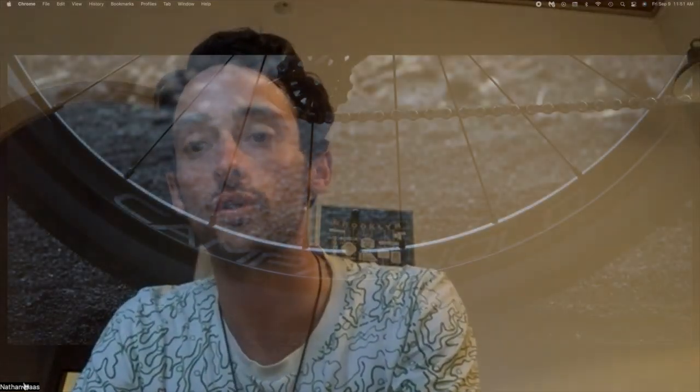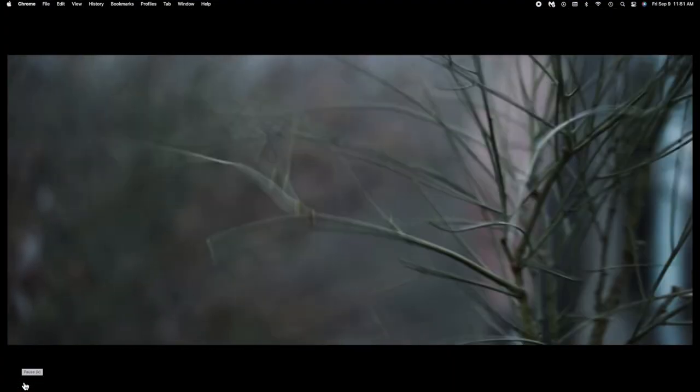One of the cool things about the Levante is it's been engineered so the wheel is almost vertically compliant, but only at the contact point. If you hit a rock or a sharp bump, there's almost suspension in the wheel. It makes the ride feel very cushiony off the wheel, but because of the traditional spoke pattern — more spokes, tighter build — you get that vertical compliance without any lateral rocking. You can actually see in slow-motion video that the rim comes in on itself just a little bit, then flexes straight back without any deformity.